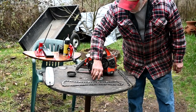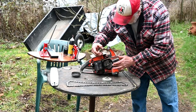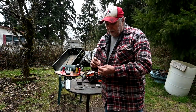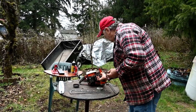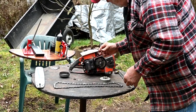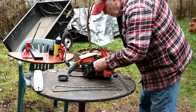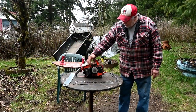We'll get the clutch serviced here. There's the bearing, then there's a plate — you always want to clean behind here around where the seal is, and put a little light lubricant on there on this side too. I'll get the bearing greased — this is unusual, it's got a sleeve inside the bearing that fits on the crank, so we need to put a little bit of grease on that. I also need to lube the shaft here. I'll get this installed — there's this washer, it goes on first — be right back.